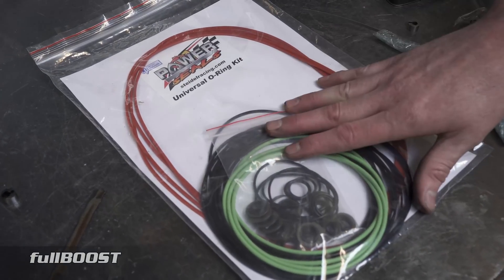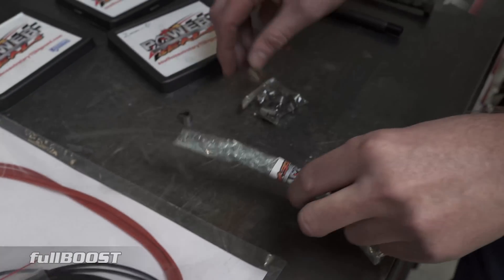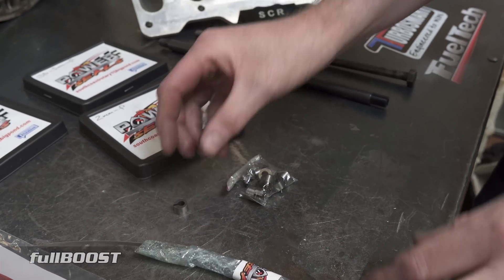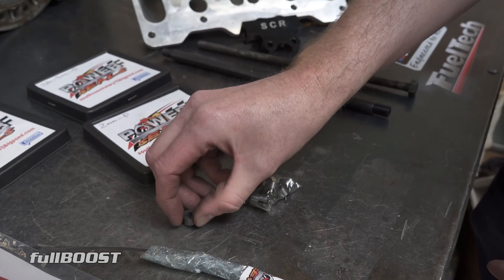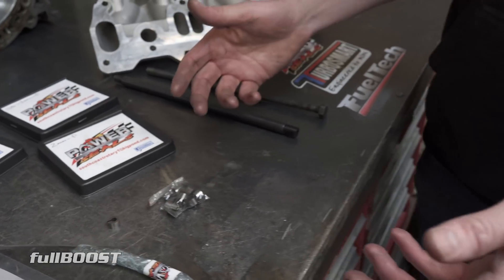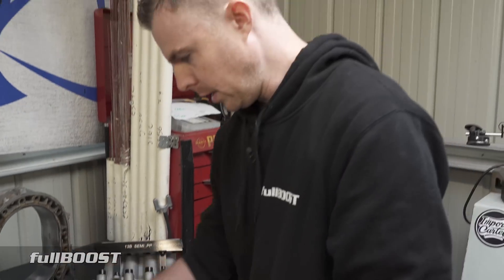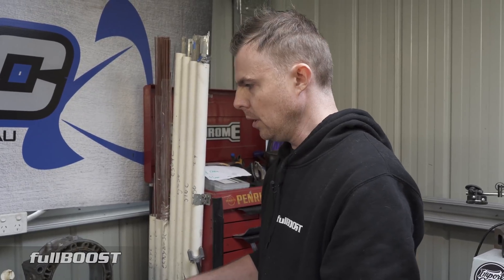You can see other services South Coast offers - there's a Power Seal o-ring kit, side seals, and corner seals. These corner seals are the springy type and they also aid in much better starting compression. The biggest thing about rotaries is when they sometimes lose compression - RX-8 owners know it only too well - the engine won't start. So apex seals, corner seals, and side seals combined will aid in much better start-up compression, which is the hardest thing when you have compression loss.